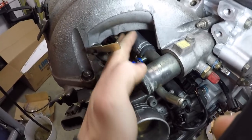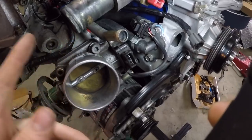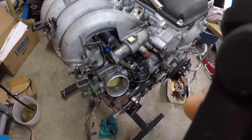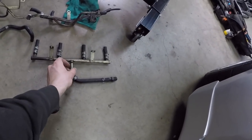There's the other line to the heater core, and then where that blue cap is, that's one of the lines for the loop through the throttle body and intake manifold — I just capped that off. If you are running water lines to your turbo, then that's what you'll use for one of them.